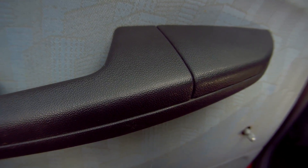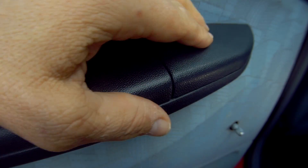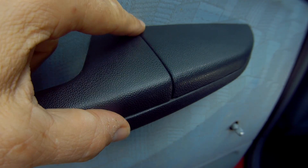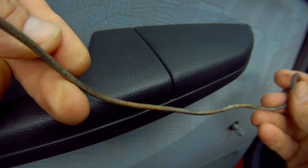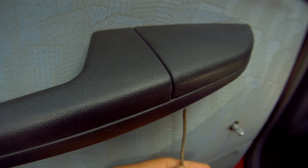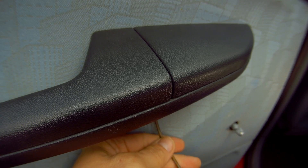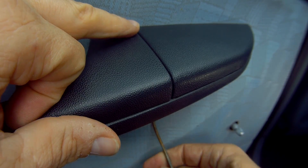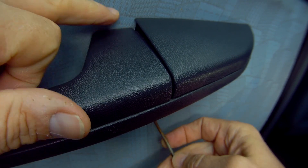The door handle is exactly like the front handles that I showed you in another video. You have to take the front panel off first by using a thin bent screwdriver or a bit of stiff wire to release the back of the panel. There is a small hole underneath that you need to insert the tool into and push up to the hooked tag and then back. The idea being that you need to unhook the tag and wangle it a bit — it'll just eventually free itself. You've just got to have the knack.